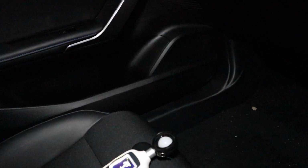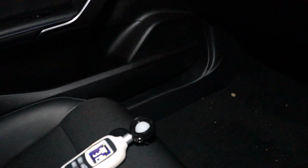Now I'll go onto the manual settings that I was on before, to show you what it actually physically looks like. Because seeing it now is hard to tell because the camera adjusts for the brighter light. So I'll go onto the exact same manual settings. Okay, this is exactly the same settings as before: F5 aperture, 1/8 shutter speed and ISO 1600. And I think you can already see the difference.